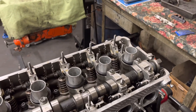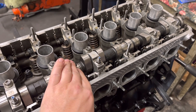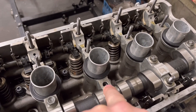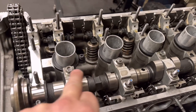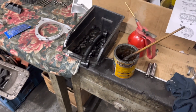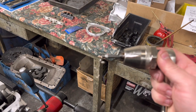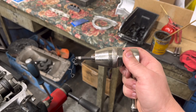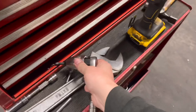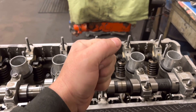There's one problem. The head is all set up, I've done all the clearances on the bench. But I was just putting in the inlet cam, torquing down the nuts, and it's actually pulled three of the threads. It's pulled this thread, which obviously holds a stud, and pulled these two. When I mean pulled the threads — you can see on the stud extractor the remainder of the aluminium thread out of the cylinder head on the stud. When you come to torque it up, rather than go tight it just continues to go, and you can feel it — something's not right — it's just pulling the thread out of the cylinder head.